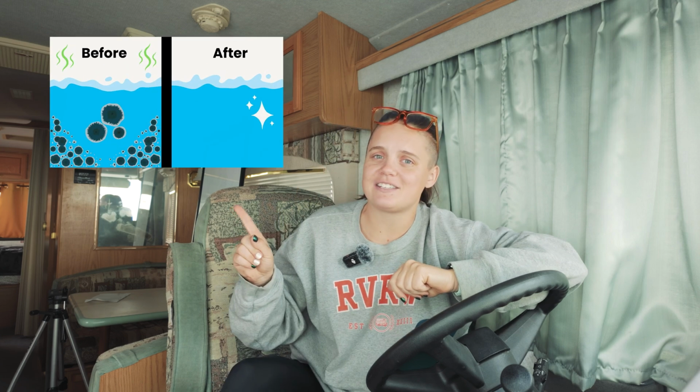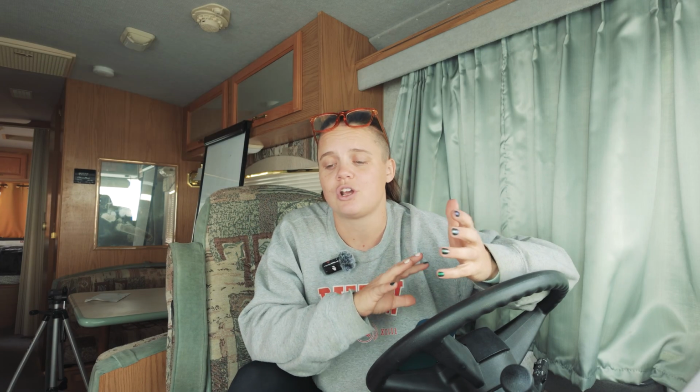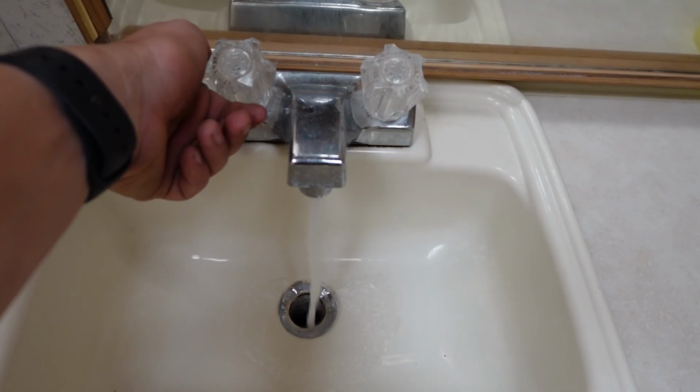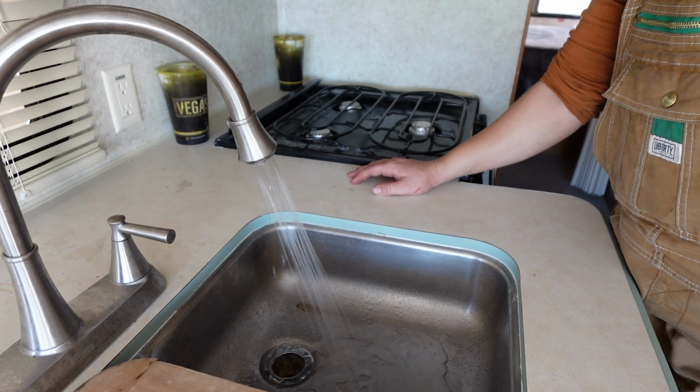You can check out this video where I give this whole process in greater detail, but the basics is going to be, you're going to measure out about a quarter cup of bleach for every 15 gallons that your fresh water tank can hold. Mix that bleach up with some water and then pour it into your fresh water tank, top it off with some more water, and then just one by one run all of your sinks, your showers, anywhere where water can go through to distribute that bleach mixture throughout the whole freshwater system.